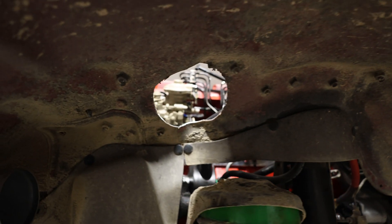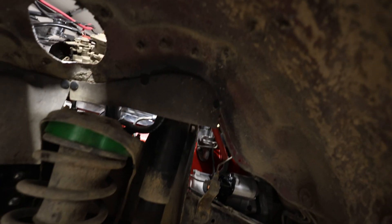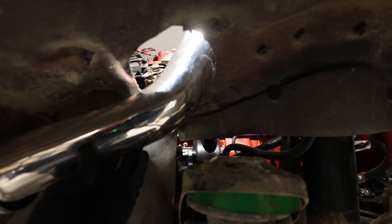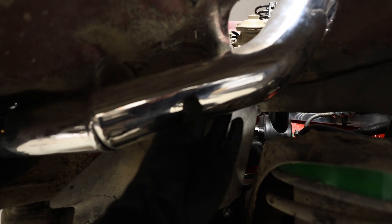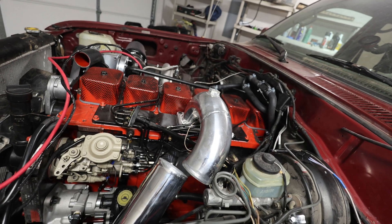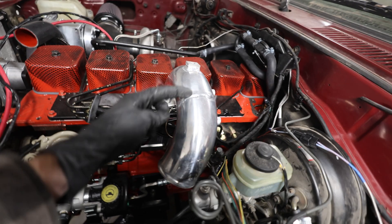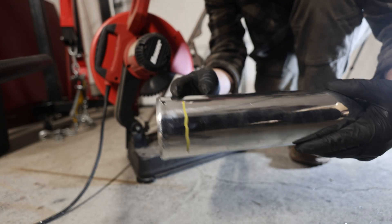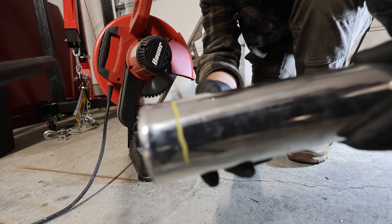It's always a little sketchy cutting through your fenders like this and we will have to find a way to reseal it, but I'm pretty happy with the location of the hole that was drilled. We're gonna have to trim these pieces to get the angle right — it's riding up against that far backside. We can trim this so that we have enough room for the angle. Up top we're looking pretty good. Remember we can always cut right around where that weld bead is and clock the intake a little bit more down as well.